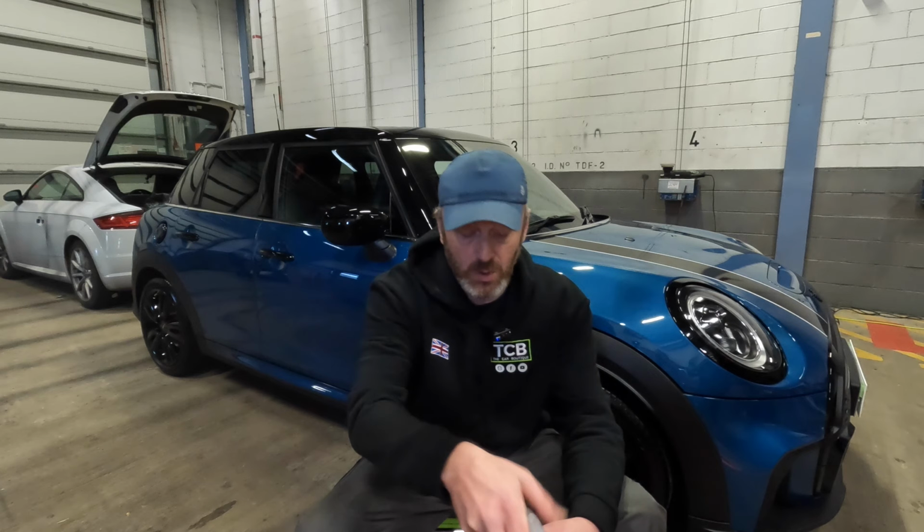So there we go, folks, all done. That was absolutely effortless. So top tip when you are using that Cupido, make sure, like I said in the intro when we started this bit of the process, small panels and level it while it's still wet. If you let it dry, it becomes problematic. Now, the golden rule I use in terms of dictating how big an area is: if I physically have to move myself, it's too big an area. So just what's accessible in one position. So the car is looking absolutely stunning.